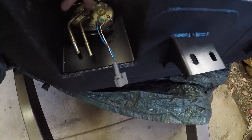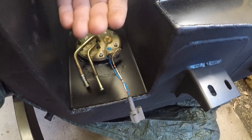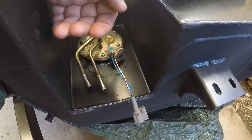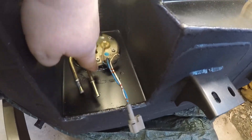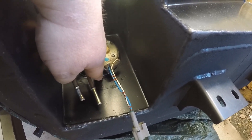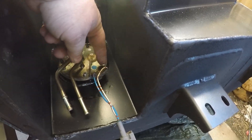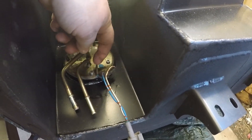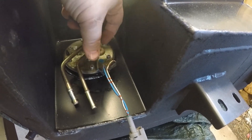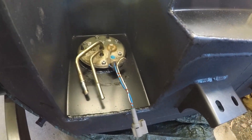After all the mucking around, I've got that in. I had to swap filters on it and bend up the base of the motor holder where the rubber sits, to try and lift everything up a bit because it was fouling in the bottom of the tank. This is probably about one or two millimetres too low. I did contemplate putting the old gasket on top of the new gasket to get a bit of depth, but the screws wouldn't be long enough — you don't want too thick a joint with a used gasket.